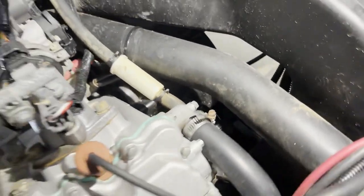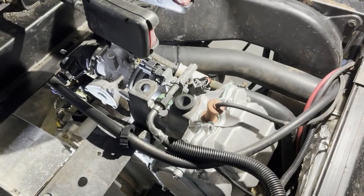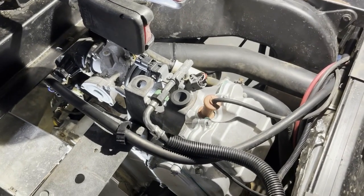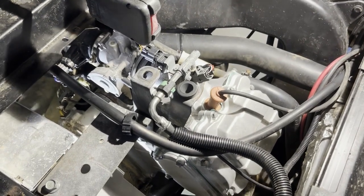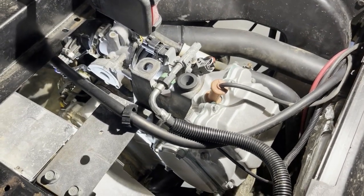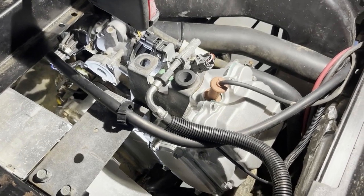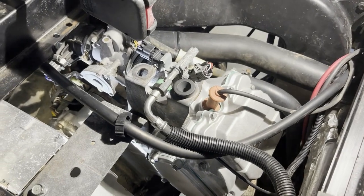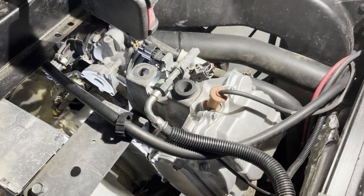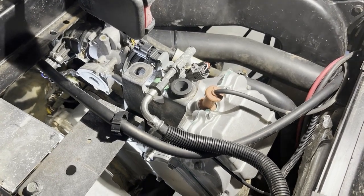Then it's just a matter of sitting back and watching your gauges to make sure your machine does not run hot. Once your fan cycles a couple times and you've got no hot signs, or your screen's not flashing hot or anything like that, your system is usually burped. Just let it cool off, go back and check your antifreeze, and you're good to go. If you find this video helpful, don't forget to like and share it with your friends — thanks for watching!